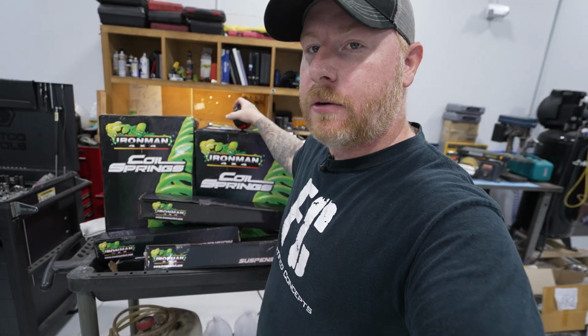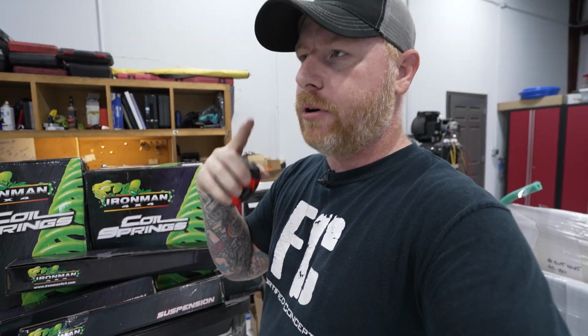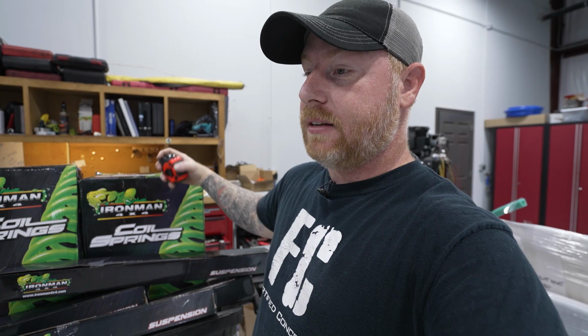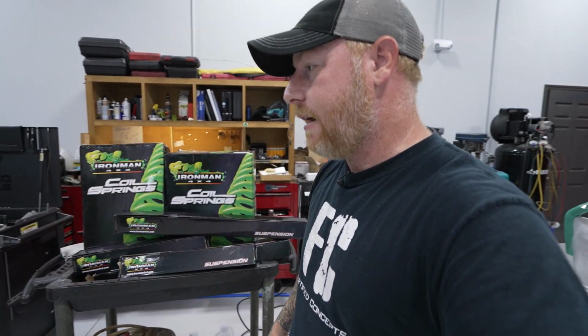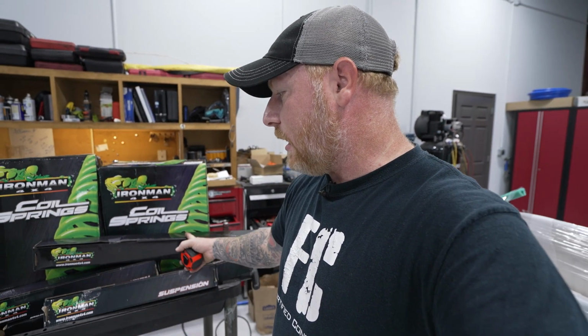Okay, so I went with the Ironman 4x4 2.5-inch lift for this. I think I did the medium duty weight. I will verify that. I'll put it on the screen or put links in the description to what I'm putting on here. Because I have so much weight, I wanted at least medium duty springs to handle that weight and to give it enough lift and not end up with a sagging situation like I have now. This also has the foam cell shocks from Ironman 4x4, which is what they're known for. I've heard nothing but incredible things about it, so I'm excited to see how those do.